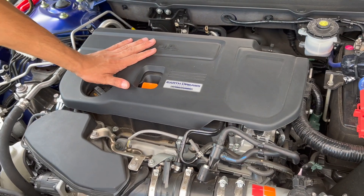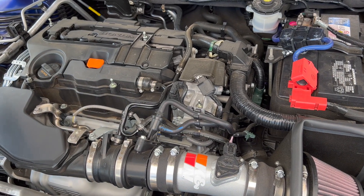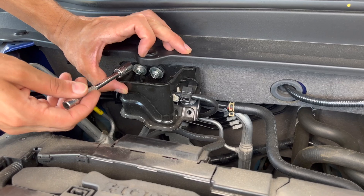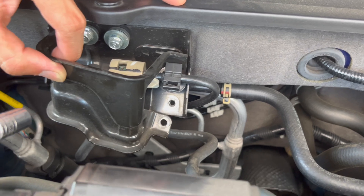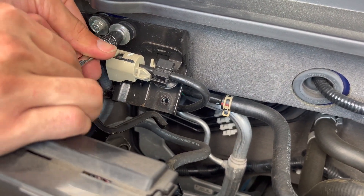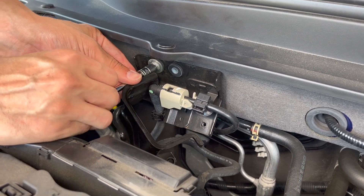On this side you've got to remove the engine cover. I'm exhausted so I might be a little slow. Just like that — just some rubber pieces pushed into this. We're going to loosen this up with a 10 millimeter socket. I removed the 10 millimeter bolt from here so I could loosen this up a little bit to have some space to get in there. That's all you have to do. Once it's out, make sure not to drop it anywhere. Put these back so you know where they belong — this one comes right out easily. Put them to the side.